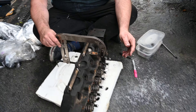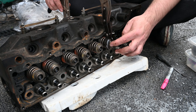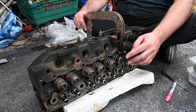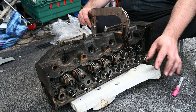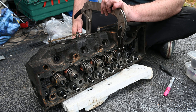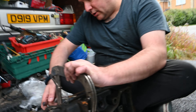I'm going to take off this inlet valve using this special tool. How it works is the valve is secured in place by a cotter, which is like a wedge to stop it slipping out. You use this tool and it compresses the spring. You can then expose the cotter, take that out, release it, and out pops the spring. Here we go, let's demonstrate this — this is one I borrowed off someone.